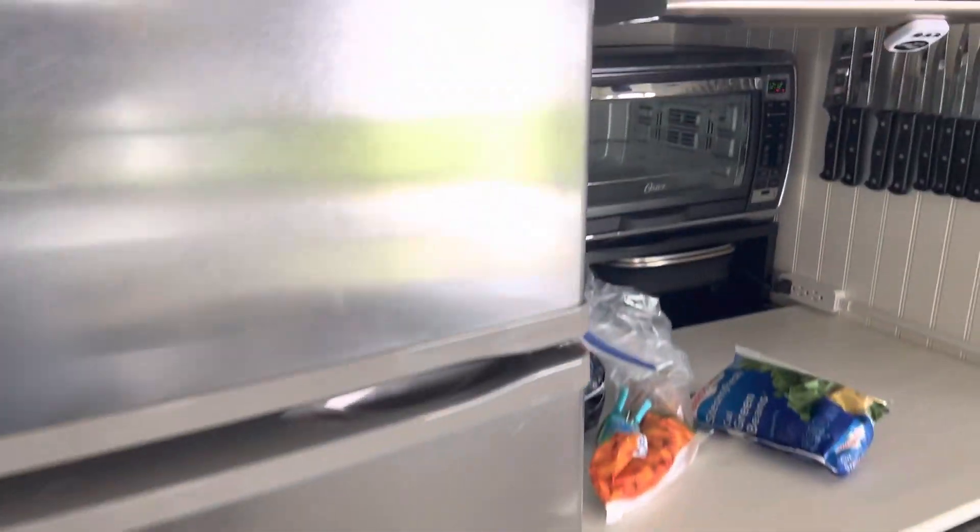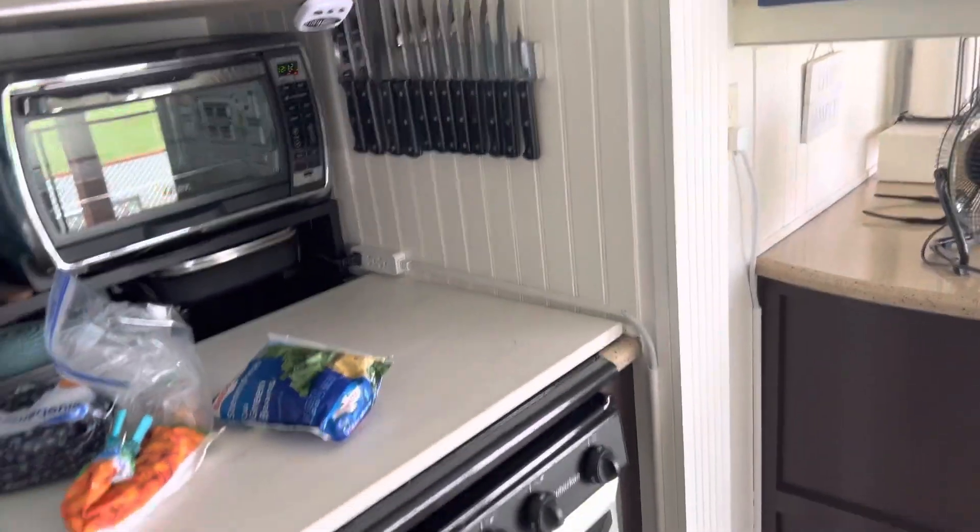So in this case, I don't have any ice water with me, so I'm just going to use the freezer and put the thermistor inside here in the freezer. You want to have a range of 7,000 to 10,000 ohms.